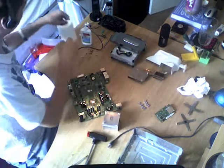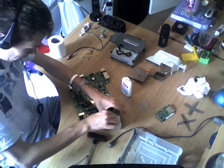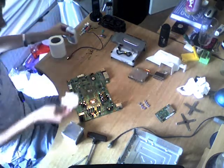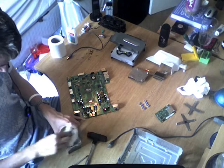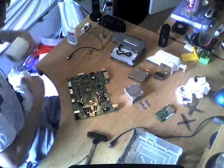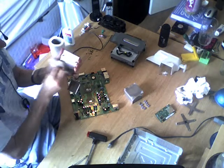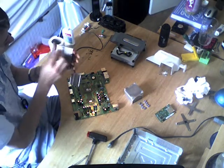You need to clean your heatsinks as well, just very quickly using the same alcohol rub and a bit of tissue paper. Now, I haven't fixed this Xbox yet so I don't know if this will work first time — I'm hoping it will. I voided the warranty today because I'm not paying Microsoft to take it and try to repair it. I'd rather do it myself for far less money. The heatsink cleaner probably cost me three pounds, and the bolts didn't cost me anything because I just had them knocking around in the shed.